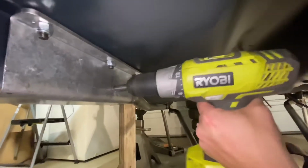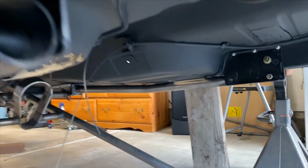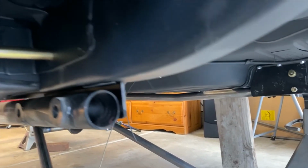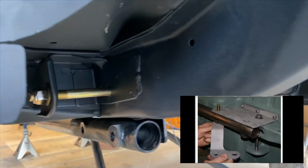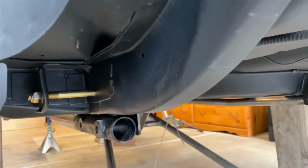This is not a bolt alert, but remember those 3.5-inch bolts from pick 5? Well, now they're being moved to a different hole, the more forward hole right here in the subframe support plate, which also goes through the subframe connector. Now adding the trailing arm brackets, which are kind of the shape of an L. We're installing the L trailing arm brackets outboard, and now, just for this moment, we're letting it dangle.